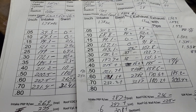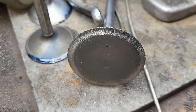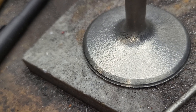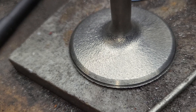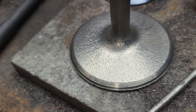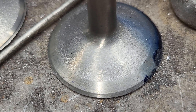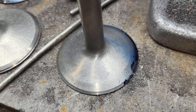I should show you a valve I experimented on. This is a valve I use as a protector valve now, but I did an experiment on it a while ago. Take a look at the texture I put on it — that texture worked really well at breaking up the fuel when it hits on it. I don't know if I have any extra 318 valves we can waste to try that experiment, but that might be worth it: cut it like this, then texture it. You might be able to get the best of both worlds — a little bit higher flow and a little bit better liquid performance.